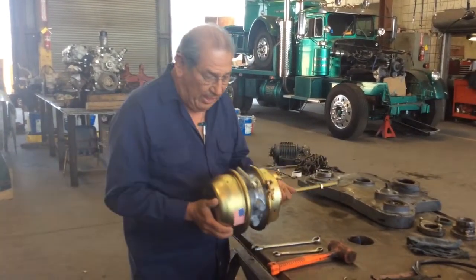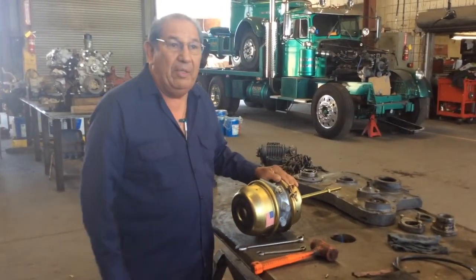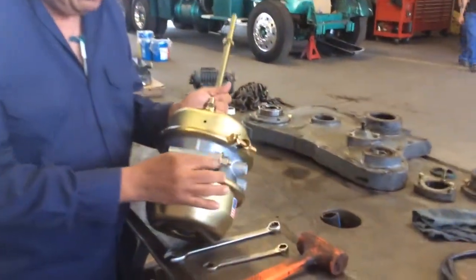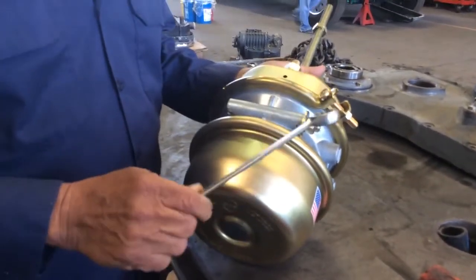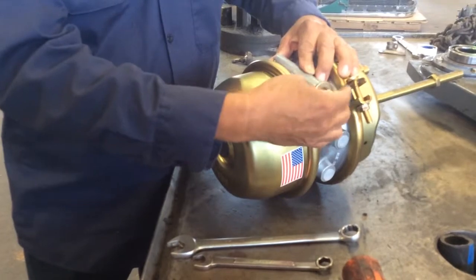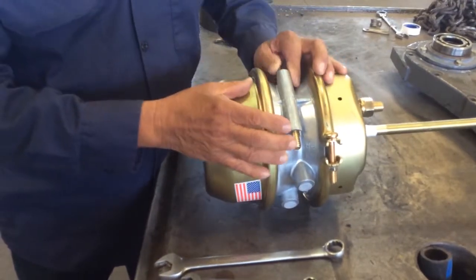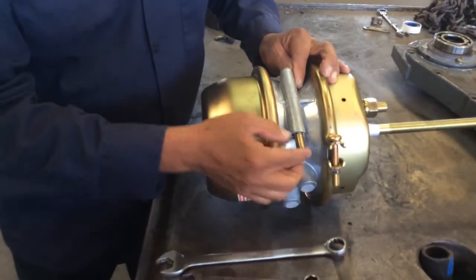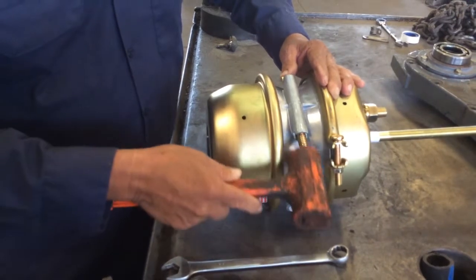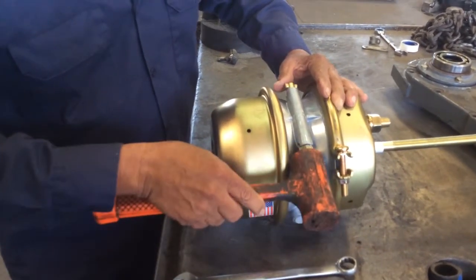On the maxi can, you're going to find one side is sealed all the way around — that's for your safety. We've got to cage it, and what you're going to find is a caging bolt right here. That's this thing on top with a washer. You'll need a three-quarter wrench or a crescent will work just fine. You're going to take that nut and washer off. Yours is going to be all filled up with dirt and sand, so get a hammer or whatever else you can and tap that out. If you're afraid you'll damage the end of it, put your nut back on just a little bit and you can tap it out through there.